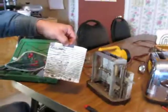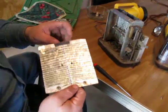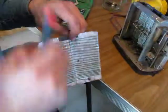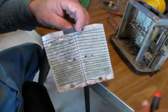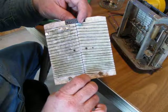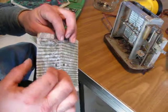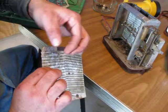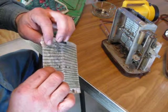Well, I've got you here — I'll show you this element repair. I'll hand this back to my assistant. Now, this element was damaged, and somebody had jammed a screwdriver, a knife, or a fork, and ripped this wire out into the open. It's amazing they didn't get it into the guide wires and short out the toaster, but they didn't. So what I did is I took the element out and folded this corner in far enough to where I could get that nichrome wire hooked back behind it again.